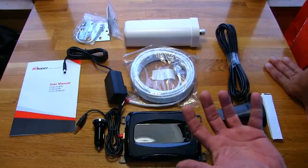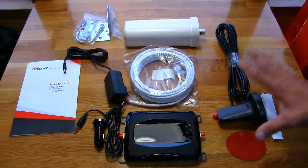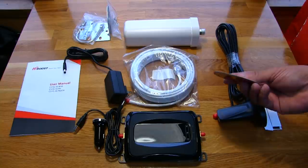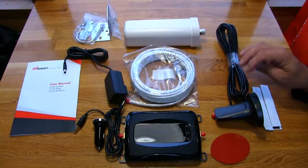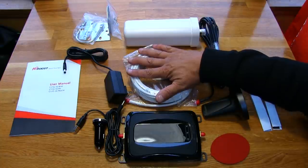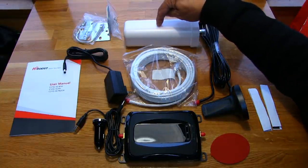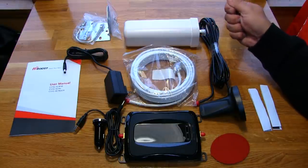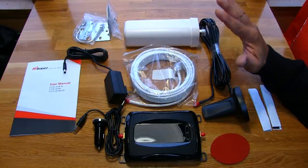For permanent mounting, a more direct power supply method is best. It operates from 5 to 12 volts according to the directions. The internal antenna has some extra accessories: stick-on velcro if you want it removable, a 3M sticky tape to stick it right on, or a built-in magnet so you can just stick it on to something metal. Right off the bat I'm very impressed with the amount of external wire they sent. When you install this, there's something specific you need to know: this external antenna needs to be as far away from the internal antenna as you can get. This works not unlike a public address system — if the microphone is too close to the speaker, you get feedback. These two antennas too close together will cause feedback and make your cell phone boosting signal useless.